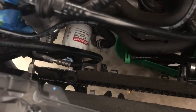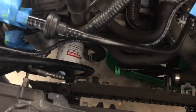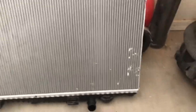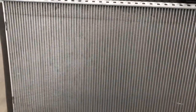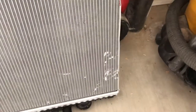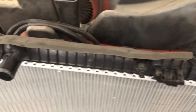Going to get into the car, tilt the radiator, get it out, and we're done for now. Radiator's out. I didn't do any favors right here when I was trying to get that fan shroud out. Don't forget to release these top posts — I wouldn't have done nearly that damage if I'd had those posts released. You can see I barely nicked it up here, but that damage is from the post being in while trying to get past the AC stuff.